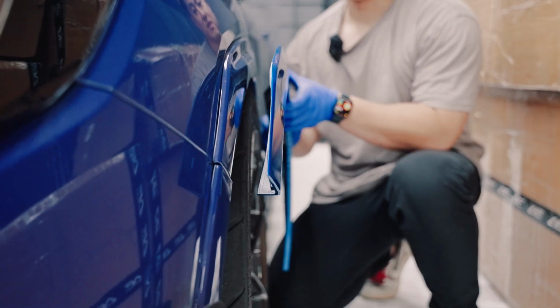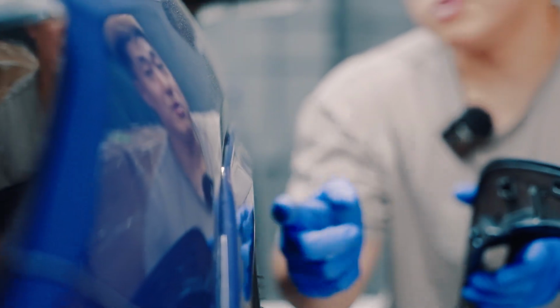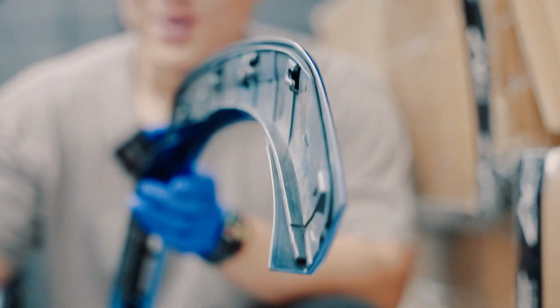Here you can see the difference between the 10mm and the regular. So, big difference. Without my 10mm, I wouldn't be able to run a 265, 22 offset in the front, which is insane, by the way. I'm rubbing a little bit right now, and on the other side, I don't know why. So on the inside, we probably need to trim all this to run it.